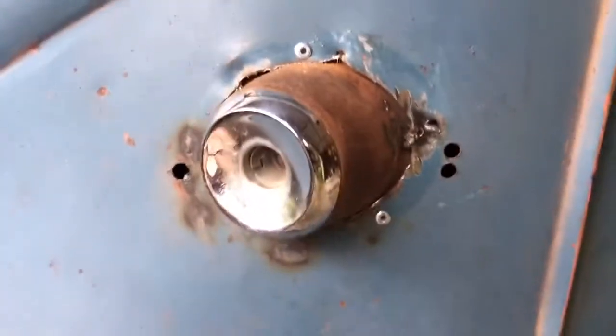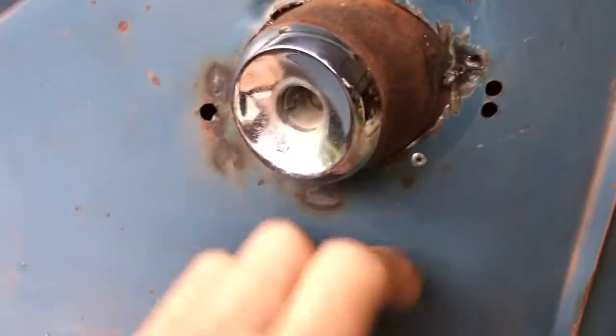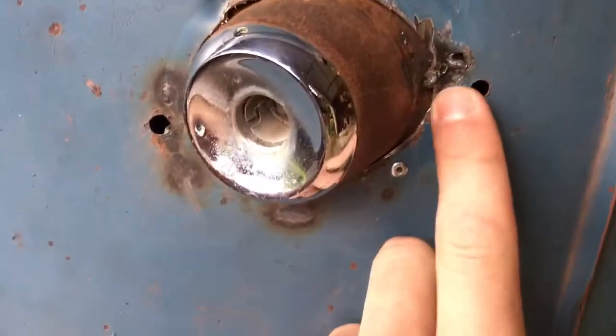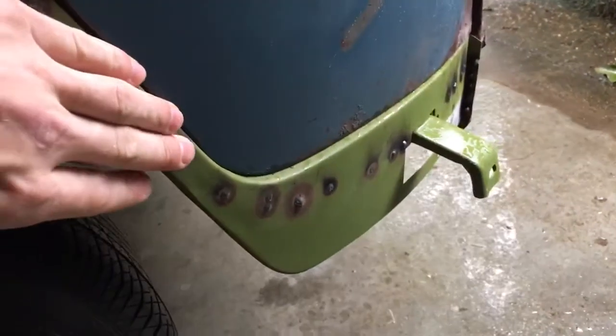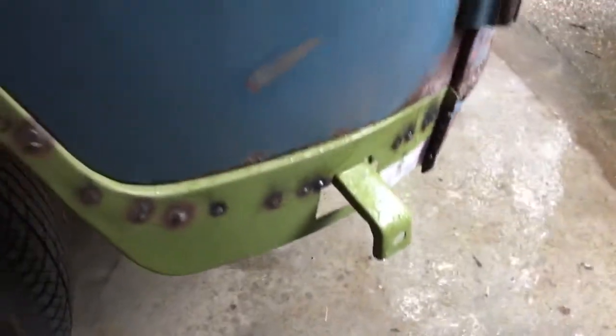Finally got these turn signals in. I've got to patch the existing holes that someone made with their makeshift setup here and clean this up — it's riveted now. It's been the hardest time getting it to stay in place; I'm trying to weld and you can see where I've torched it. I have plans for fixing that plastic — it's shiny — but we'll have to do something about the holes here. Passenger dog leg is in as well; same scenario — I wasn't getting enough penetration on the bottom section, so we'll have some stuff to fix up.